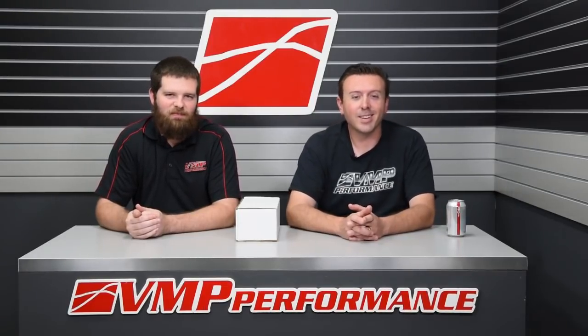And he finally dynoed his car because he's never dynoed it before. His setup is very mild: 69 millimeter upper pulley, Illuminator oil pump gears, and crank sprocket. And it made 888 rear wheel horsepower through the 6R80, on a Gen 1 Coyote with a 69 6 rib. Not too shabby. Not even an overdrive balancer. And just pump 85, or like C85? I think he's using like a C85. Okay. Yeah. He's like, oh shucks, and then he goes, woot woot.